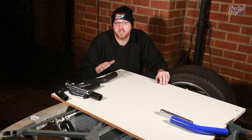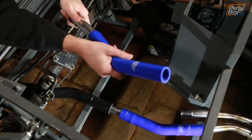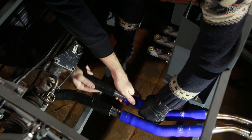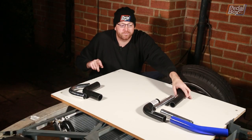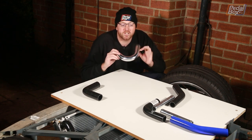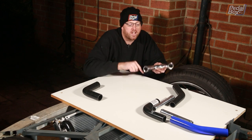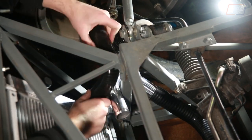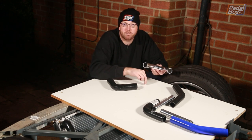The driver's side isn't quite as easy as the passenger side. We start with the same 15-degree bend and a 200mm piece of hard line to bring us underneath the rack so we can mount it securely. Then a 90-degree bend takes us towards this side of the car, a 200mm piece of pipe, and then an adapter from 32 to 38mm — we've gone up to 38 purely because of parts availability. Then a 135-degree bend takes us around the pillar at this corner of the car, and a 90-degree bend shortened down gets onto the outlet at the bottom corner of the radiator that sits right next to the pillar.